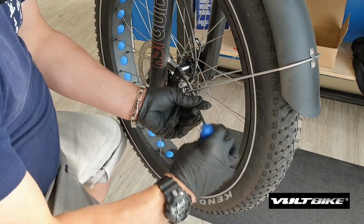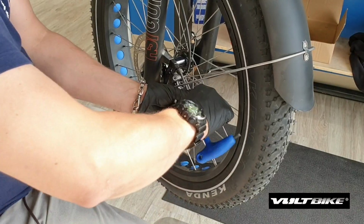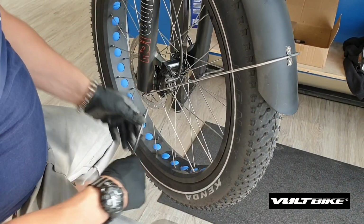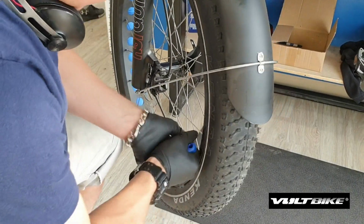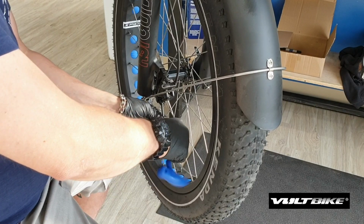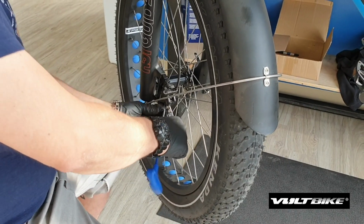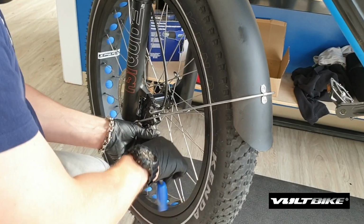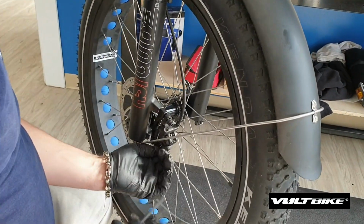And this is a wonderful example of why we change our pads if we don't maintain them properly. These pads are completely contaminated with WD-40 and as a result will not stop the bike. Please refer to our disc rotor cleaning video as well as pad modification video for the 2 steps before this. And you'll have good braking every time.